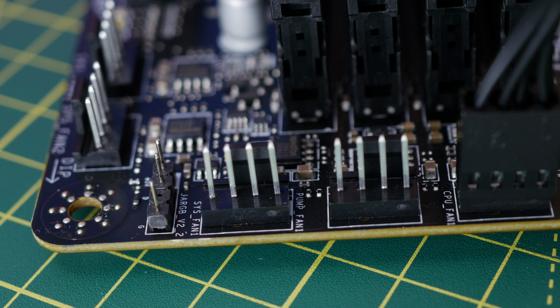But if you're trying to keep costs down, or you just want to control the RGB lighting for a number of different fans, then this Thermalright RGB hub makes a lot of sense. Also looks really nice until you get fingerprints all over it, but that's unrelated. And you can obviously nestle this away at the back of your case, then just run this single cable through to the motherboard, plug it into that 5-volt RGB header on the motherboard, whichever one works for you best. I'm using the bottom middle one for this, for example, and showing you the wiring logic for that.